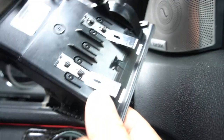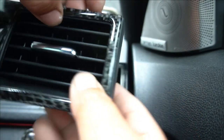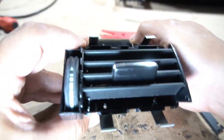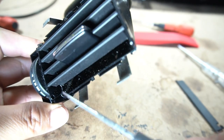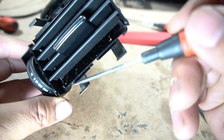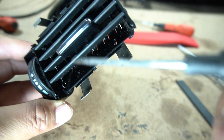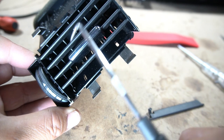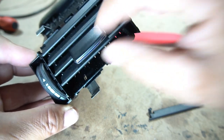Now we're going to disassemble this and show you how you can replace the air vent tab and how everything comes apart. I've just taken off the bottom louver to show you how this works. You see this metal bar in here — there's one here with an empty hole. I'll pull on it and you'll see what happens to the flaps. You notice how they go up and down, because that's what all these louvers clip into. It basically allows you to control them via the tab for the air vent.